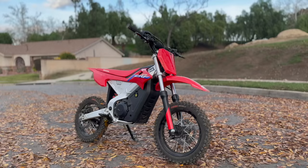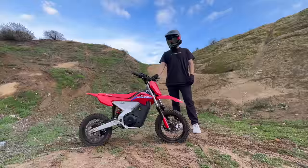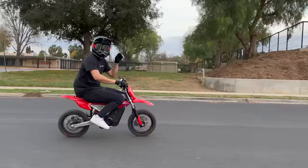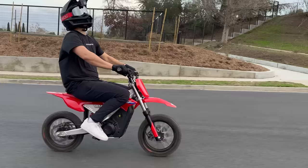The bike's electronically limited to 20 miles an hour, which isn't even close to the motor's full potential. Everything about this bike is asking to go faster — it's got a robust moto frame, moto brakes, and decent suspension. To get more out of the motor we've got to put more in. The plan: 72 volt battery upgrade, controller upgrade, and supermoto street wheels. But first we've got to strip it.